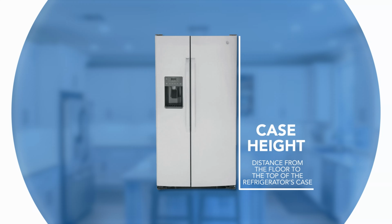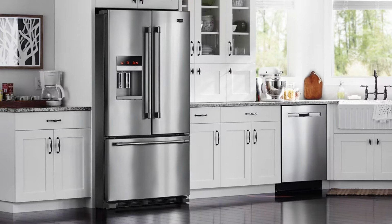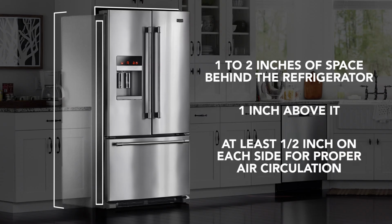to the top of the refrigerator's case, and hinge height, the distance from the floor to the top of the hinges. If the refrigerator will be installed in a space surrounded by custom cabinets, it is recommended that you leave at least 1 to 2 inches of space behind the refrigerator, 1 inch above it, and at least a ½ inch on each side for proper air circulation.